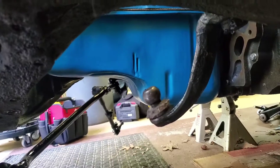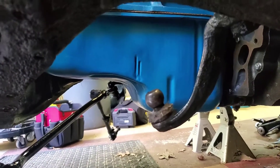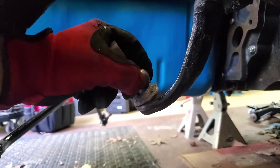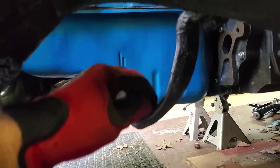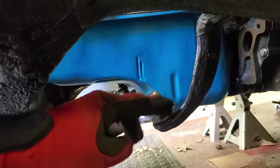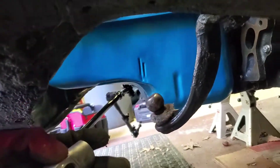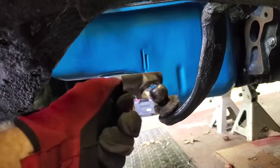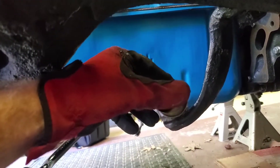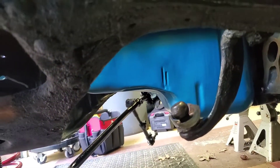I'll film trying to put the drag link down on the Pittman arm ball. There is a little felt washer right here that I believe goes to help hold up the dust cover. The hole in it is smaller than the ball so you just kind of have to wiggle it down over. Then the dust cover goes on it, with the long side pointing towards the outside of the car towards the driver's side.